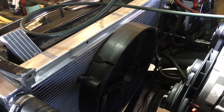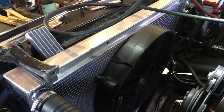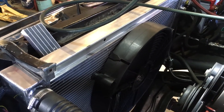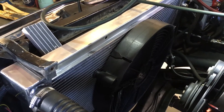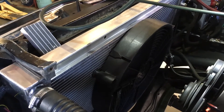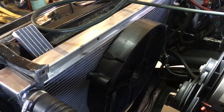What's going to be the problem here? Condensing is so important to get the gas into a liquid that we aren't going to have very cold air out of this. Running down the road it might get down to 40 or 45 degrees, but realistically around town the best we're going to see is maybe 60 or 70 degrees.